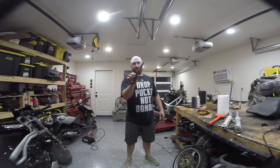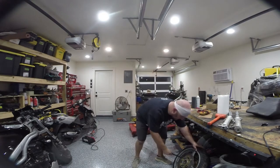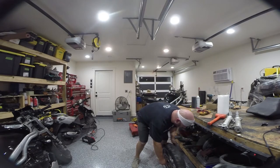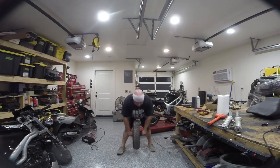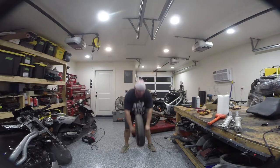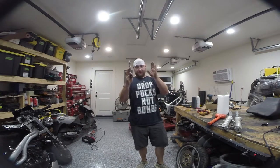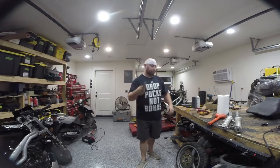On a lot of bikes, this is nothing more than a half inch impact extension. These are often about the right size. So all you really do is thread it through both sets of bearings, and then I roll it forward and hold it up and hold it level. Usually if there's any real damage or bend to the wheel, you're going to be able to look down and see it. If you look down and it seems to be perfectly straight on both edges, make sure you check both sides of it visually. That's a good wheel.